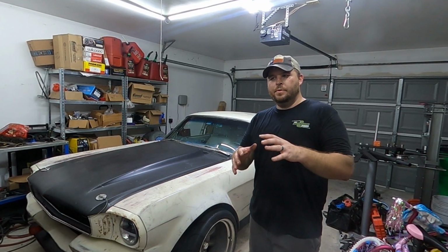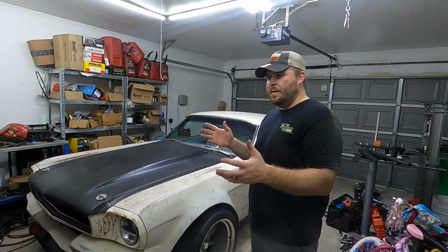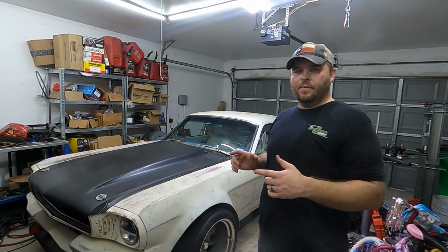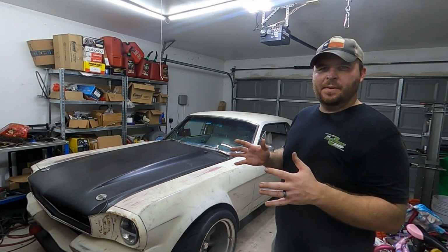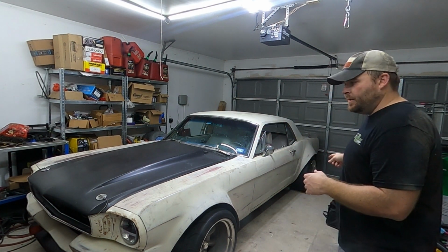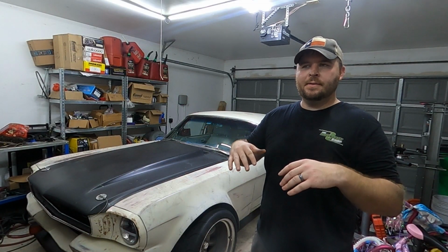So, yeah, just recapping the process, basically we took off the back half of the exhaust. We shortened that piping that goes from H pipe to muffler, so it tucked in a little bit. That way it was an immediate 90 off the muffler and toward the outside of the car. Then we positioned it where we're going to have some good ground clearance.